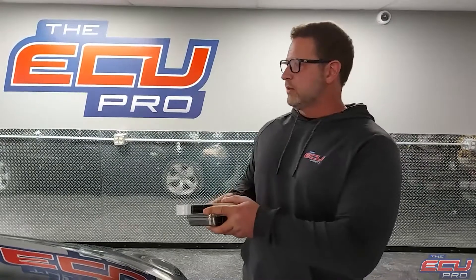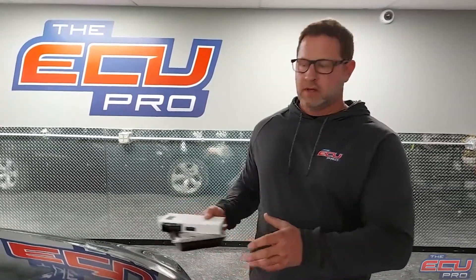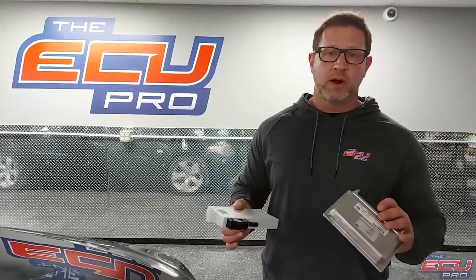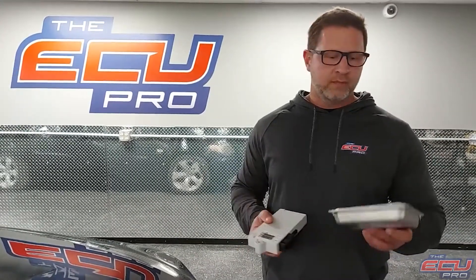The reason we want all three is we actually take one of the cars out of our fleet, install your parts into the car, start the car, run the car, and diagnose the car to figure out what the problem is. If there's no problem, we charge you a small test fee and ship all the components back so you can go to your mechanic and figure out what else is wrong with your car. If there is a problem, we can repair your DME, or if the CAS module and DME need to sync, we can do that. Or if it's water damage, we can clone it to a replacement.